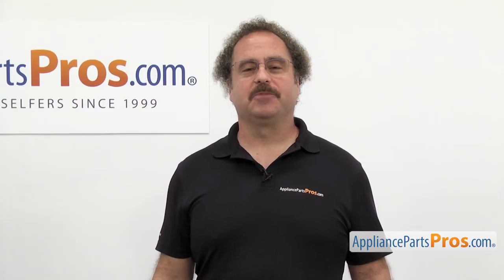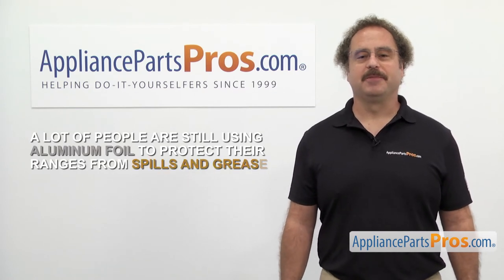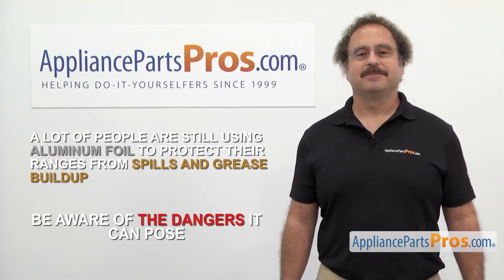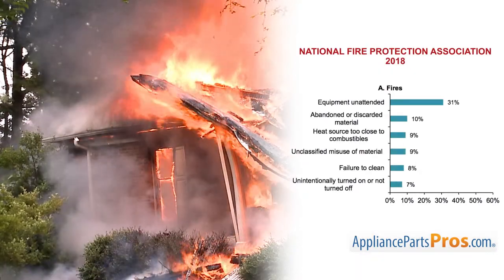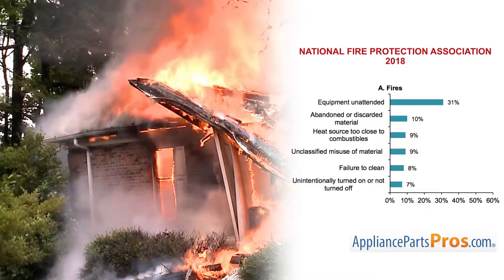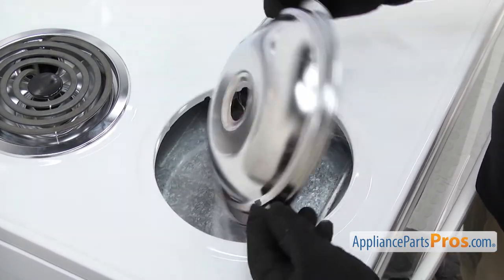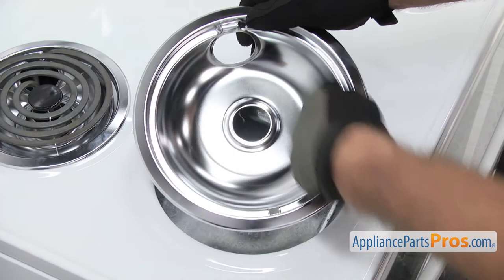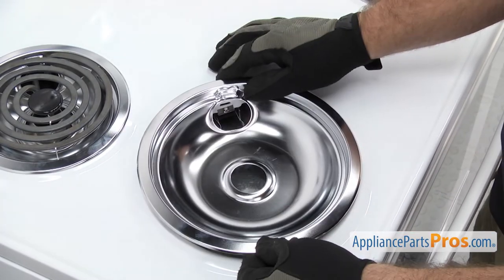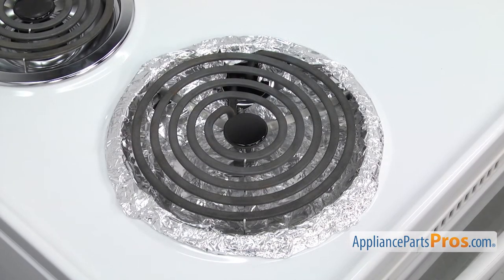Now here are those safety tips we mentioned earlier. A lot of people are still using aluminum foil to protect their ranges from spills and grease buildup. Although it may seem like a good idea, you may not be aware of the dangers it can pose. Firefighters respond to over 170,000 kitchen fires per year, and failing to keep the range clean is linked to more than 13,000 of those. On electric cooktops, many people cover the drip pans with foil, but this can cause moisture retention, making them rust even faster. It can also block airflow, reflect heat back into the elements damaging them, or if the foil touches the element, it could be a shock hazard or start a fire.